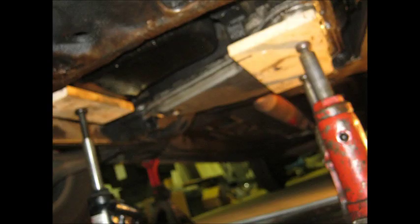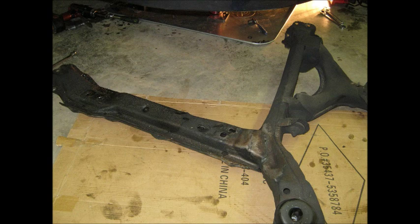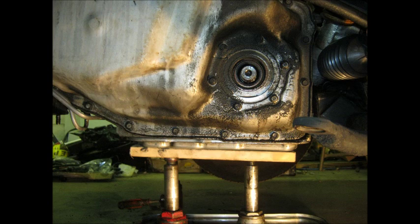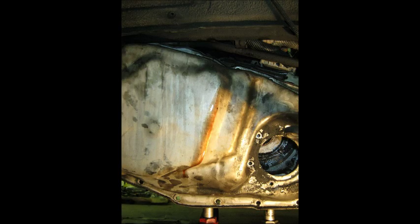The subframe looks bad but it's really not that bad — it's kind of lightweight and one person can handle it. There's one bolt that holds it on in the left front corner and a few screws on each other end. You really only need a 13 and a 15 wrench and socket to get that subframe out. Lower things down on the jacks using a wooden block to protect the bottom of the transmission. You may have to move some power steering lines out of the way to get clearance, then take all the pan bolts out for the end cover. You have to tip it down a lot to get it out — there's not a lot of room, but it can be done.